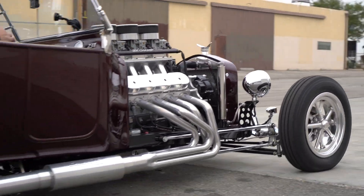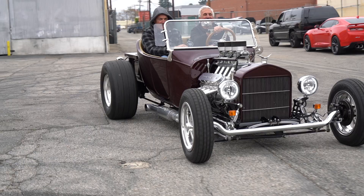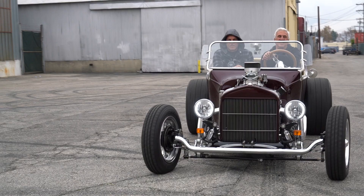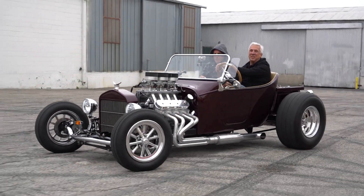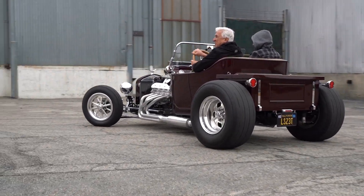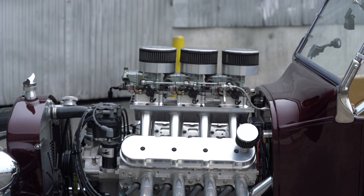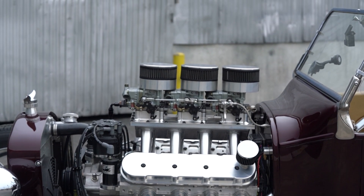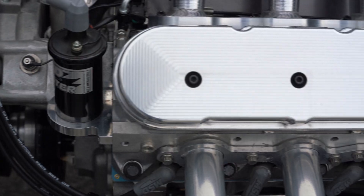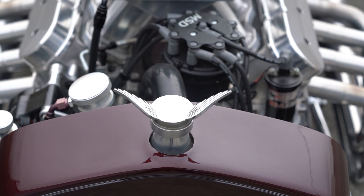All the parts in the car are full-on race parts — they came out of rebuilt motors that were retired after a certain number of miles. It literally has a $2,800 crank, Carillo rods, ported heads, titanium valves, and $300 valve springs. Bill called in a lot of favors from his racing days — he called three customers that raced two-barrel classes at Irwindale wanting carburetors. The carbs are 500 CFM race units — all three of the first customers he called sent him one. He had them anodized, rebuilt, and made to look brand new.